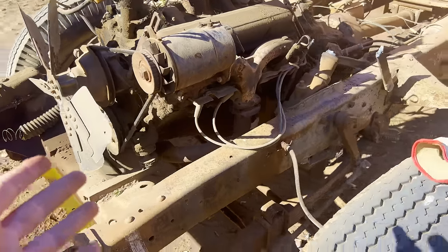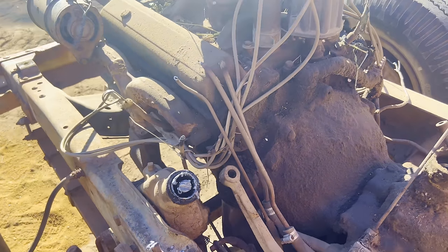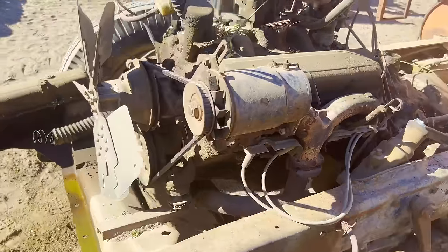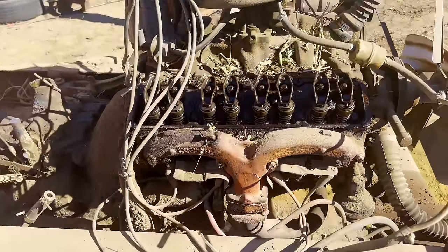It could be a 350, the block itself. The casting number on that making it a 67 might make the block worth something, unless it's been bored out crazy or something like that. The guy's going to have to tear it apart to see what it is for sure. That's pretty common out here in farm country. They will slap together whatever they have laying around. I have seen all sorts of funky stuff under the hood of these things where they piece together engines.